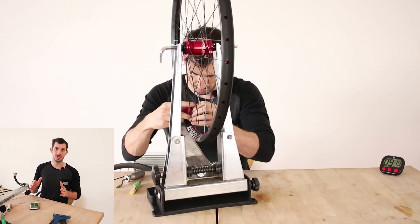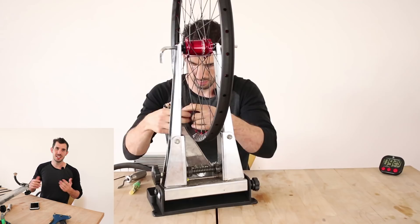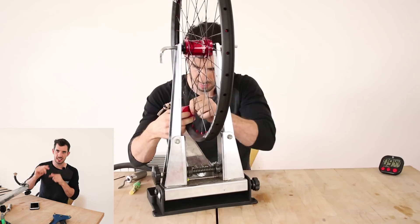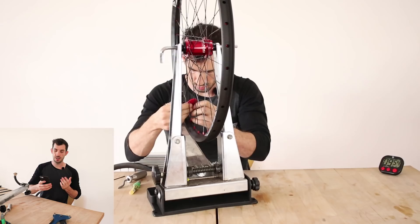Callum Irvine asked what to do if it all goes colossally wrong. I've built plenty of wheels that went completely wrong — wrong-side spokes, messed-up cross pattern. The best thing to do is start again completely: take out all the spokes and start from a fresh page. It's tedious, but it's better than trying to find exactly where the mistake is, which can get pretty confusing.